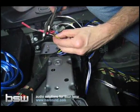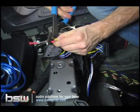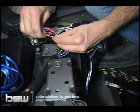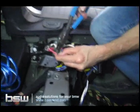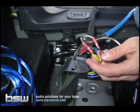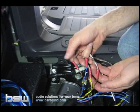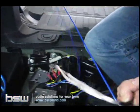Just put the wire in, crimp down. Remember, silver is negative, copper is positive. I can't hold the wire steady, there's so much WD-40 on my hand. Oh, the WD-40 is everywhere. Those are useless now. So as you can see, our positives are yellow and blue, negatives are brown, silver to brown, positive to yellow, positive to blue, and our input harness is created at this point.